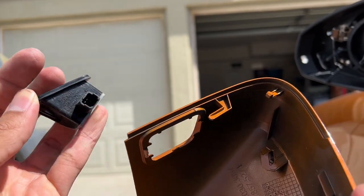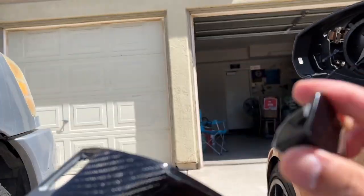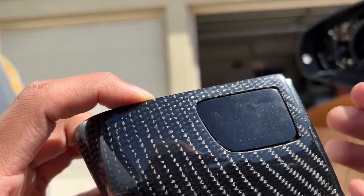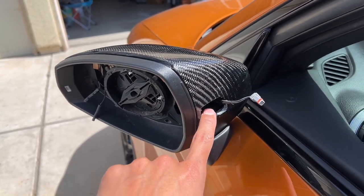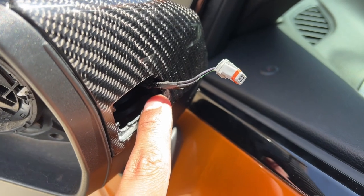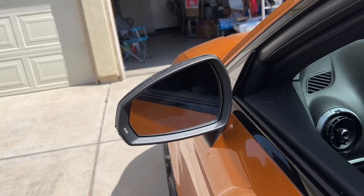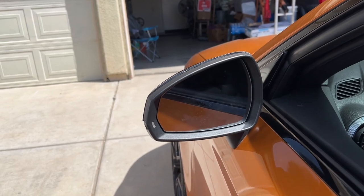Alright, so this is our new piece — the new carbon fiber mirror cap. With this light, it's a direct fit. I'll link the actual mirror caps that I bought in the description so you guys can have it if you want to go with this brand. You just put it in and snap it right back into place. One important note: when you put the mirror cap on, make sure you don't have the light in the cap first, because there's a tab in here that gets blocked if the light is in — you won't be able to get the mirror on. Take the light out first, get the cap on, then plug the light in and push it in afterwards.